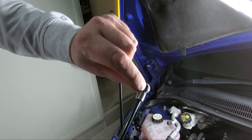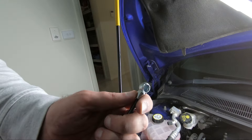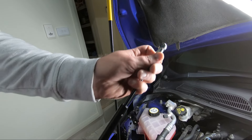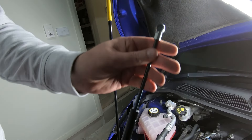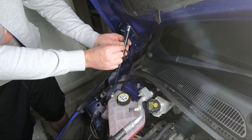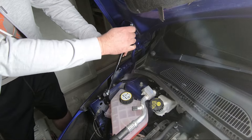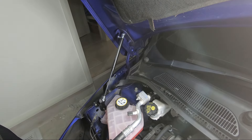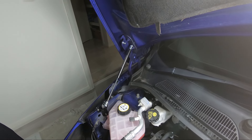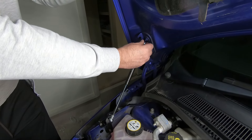Now we're up to fitting the gas strut. These ball ends come with a locking pin — you can see how it just comes through just a tiny bit; that's what locks it in place. To get them off, it's like a spring — you just pull that around and it'll slide out. To fit the gas strut, you want the cylinder part up here with the piston at the bottom; it just clicks on there. I've got my wife holding the bonnet up — come down a little bit with the bonnet and then you just click that on.